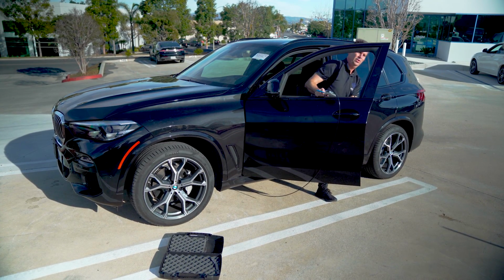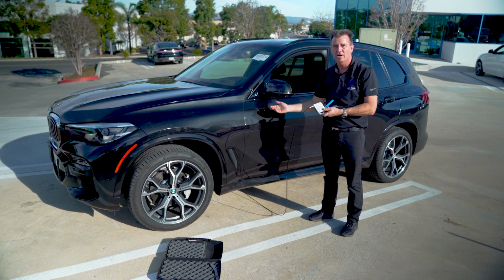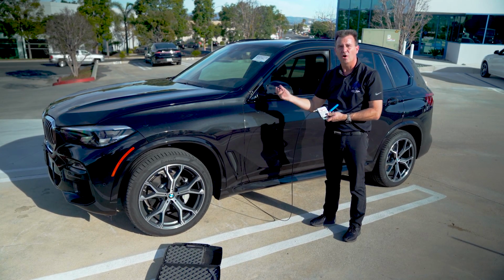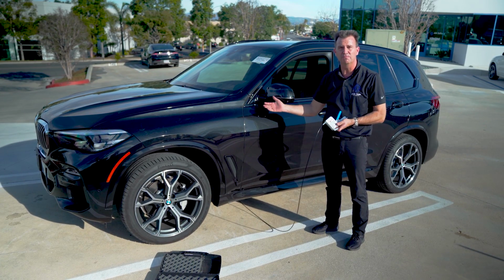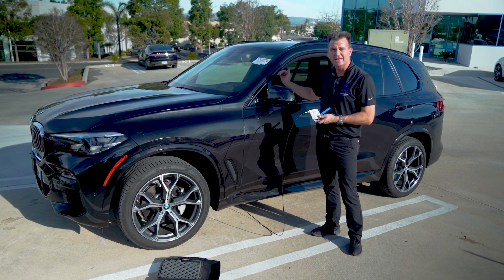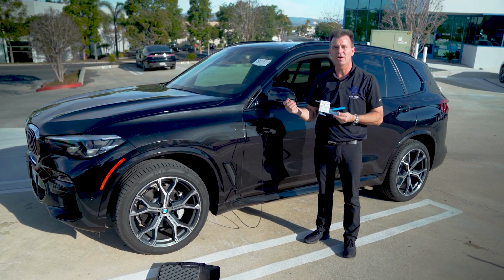Once you're done using the tool, you must get under the car, undo the lever, and then take the magnetic release tool off the transmission. Do not pull on the cable. That will damage the cable and could potentially bend the lever. Also, should you accidentally damage the cable in the door jamb or from running it over, spare cables are available